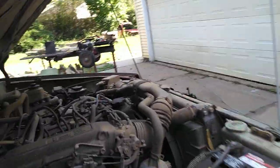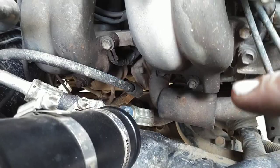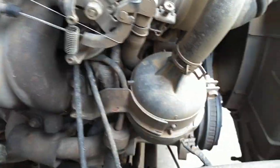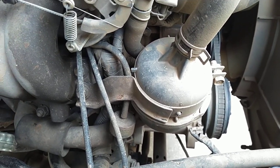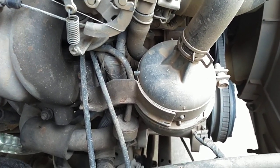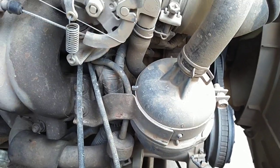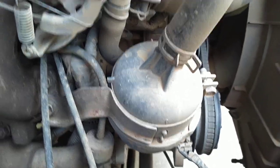So under the hood, going from the suction side in, I just have a standard line here with a service port down there, which is a hell of a lot easier than the factory Toyota location. It runs into a Sanden SD508 series compressor. I went on eBay, looked for just a generic, new old stock, new in box compressor. Found this one for like $75. There's different versions of them, but this is what I got. And the compressor's down there.